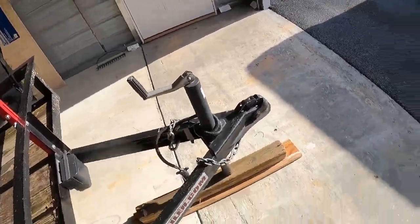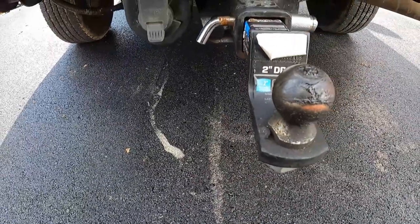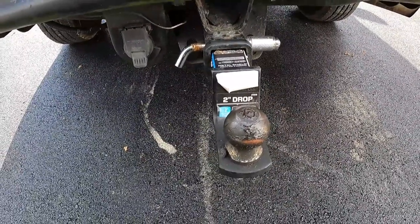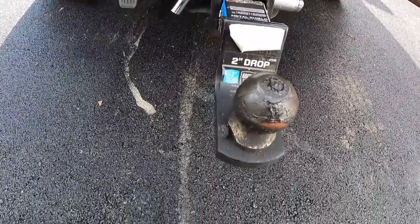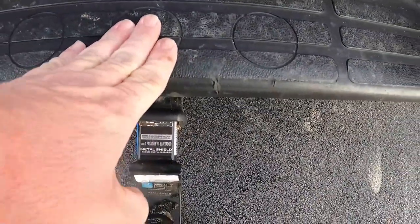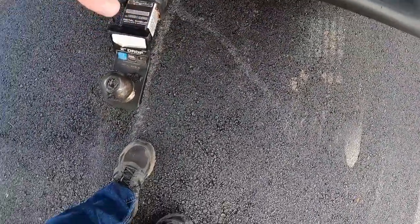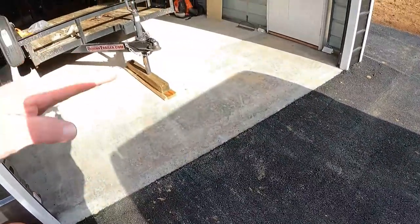Load 60/40. Your truck also has a tongue weight rating — it may be written somewhere on the truck or in your owner's manual. This truck has a receiver hitch that came factory. You can also do a bumper tow — there's a hole in the bumper — but I don't recommend it. It's too close to the truck; you'll jackknife and tear your bumper up.